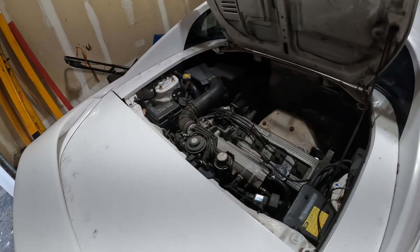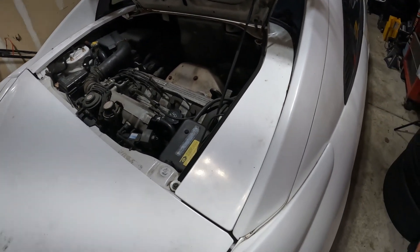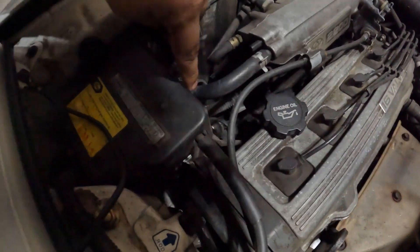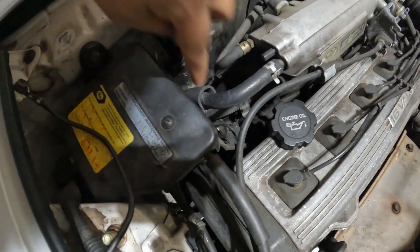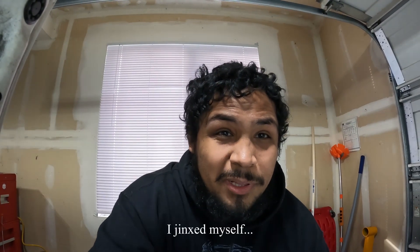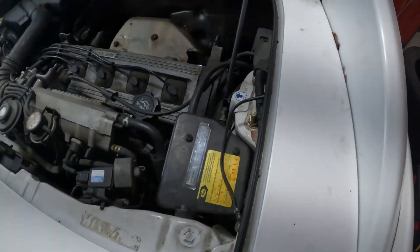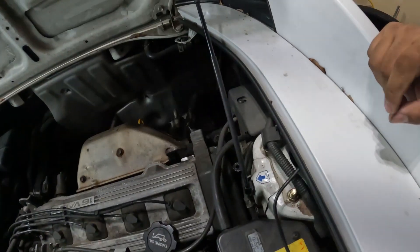The plan is to pull out the alternator to get it bench tested. I should be able to get it out through here — I'll just have to take off the side cover and cruise control module. It's tight, but there should be enough room to pull it out through that little area. To take this car apart it's really not going to take much: a screwdriver, a 10mm socket, maybe a 12mm, a couple extensions, and that's pretty much it.